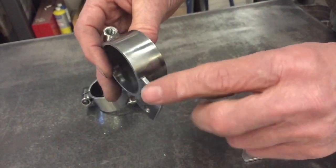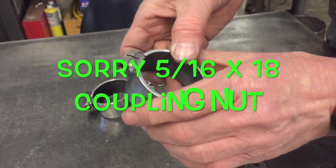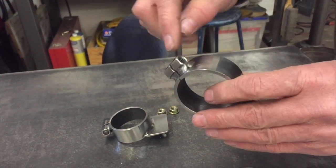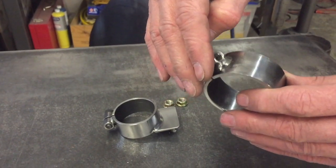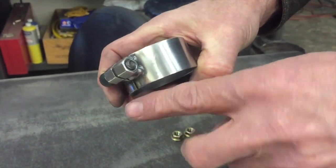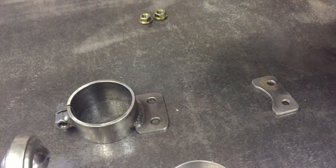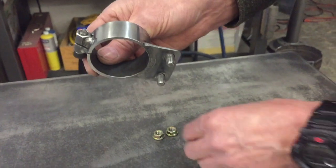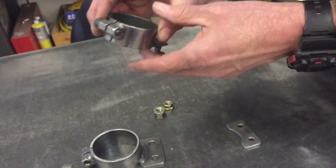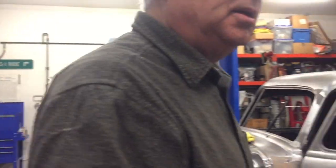I upsized the plate and went one size bigger on the coupling nut — a 5/8 coupling nut. Same thing: welded it on, cut it, and it just spread apart and opened right up. The problem with centering the coupling nut was it hit the firewall, so I had to move it up higher to clear the floor since the firewall comes up at an angle. And rather than have bolts going through it, I decided to weld studs on it so I wouldn't need somebody inside the cab putting a wrench on those. I think we're ready to install this in the truck.